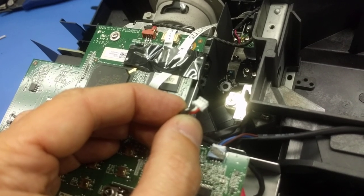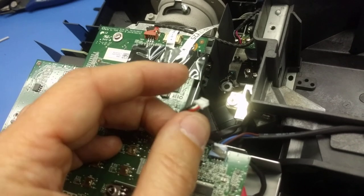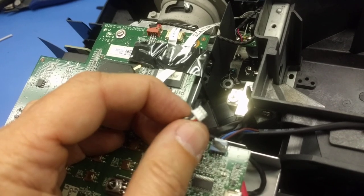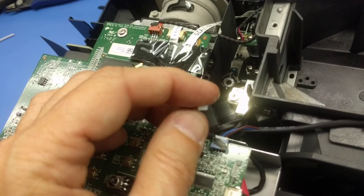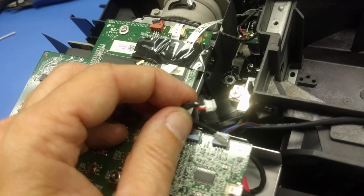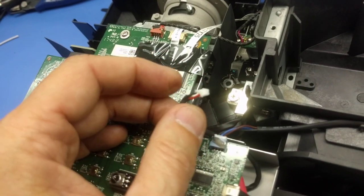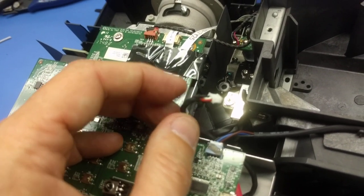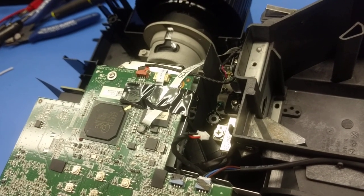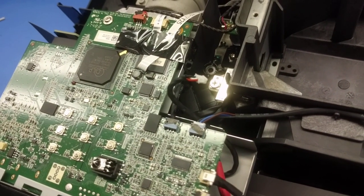And if it does, in fact, come and go, and it comes on you and then goes back to the factory and the shipping makes that connector mate temporarily again, it will run for them and they'll say, okay, great, let's ship it. Now, some other poor soul gets the thing, and after a couple of weeks, it quits. Thermally, of course, as the unit heats up and cools down, and this area gets very hot in here because of the bulb, that puts stress on that connector contact as well and can cause that to disengage and fail.